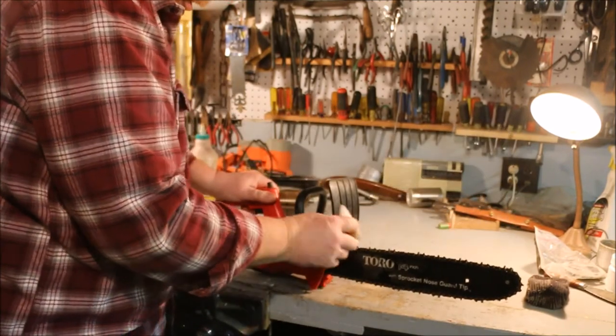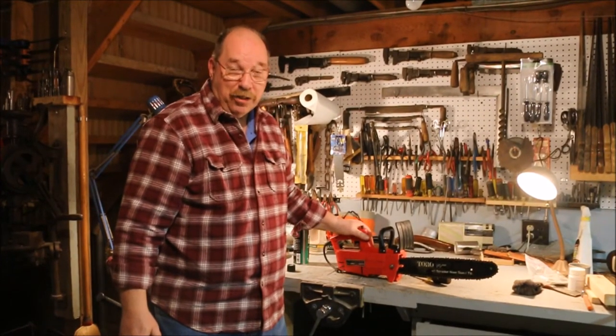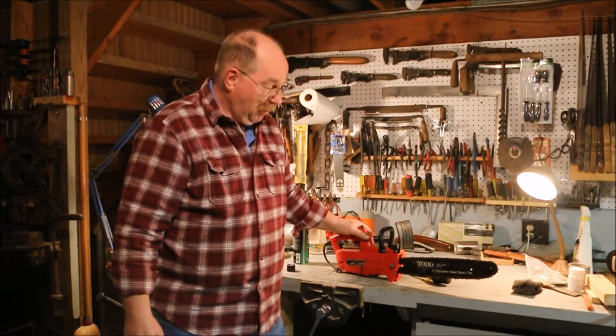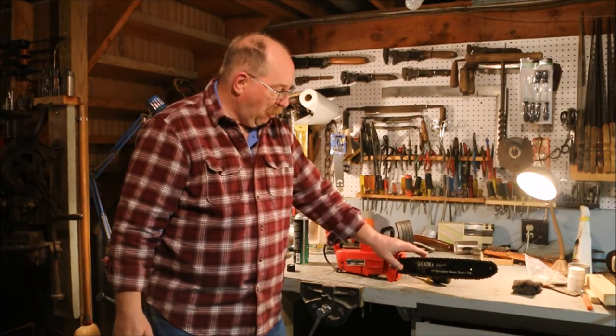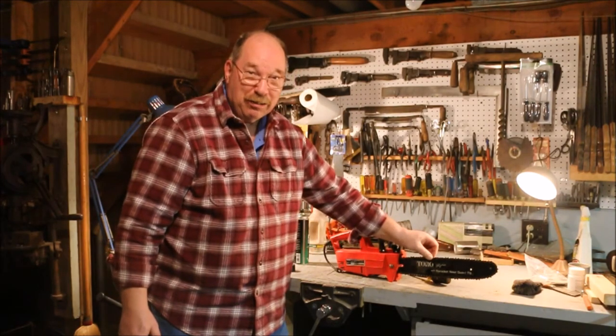But we knew that going in. The chain and the bar are wear items on any chainsaw. And this little Toro, it's showing wear on the bar and a lot of wear on the chain. I can flip the bar over, but the chain's gonna need to be replaced to take care of the problem